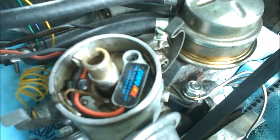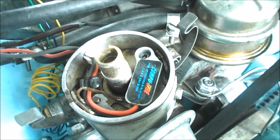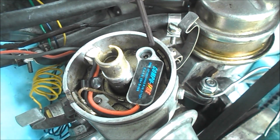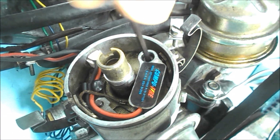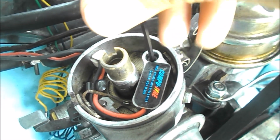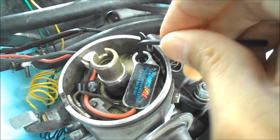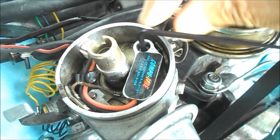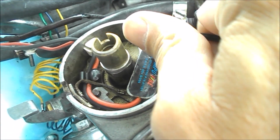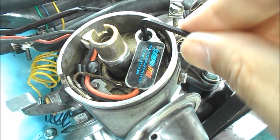Alright, there it is. Is it in focus? Yeah, I think it is. A quick optical inspection indicates to me that it may actually have backed out. I hope this is the right size wrench. It is. And look at that, you can even see it moving around. It had in fact backed out. Holy smokes, people. This was it. A loose ground. Alright, I'm going to torque it down a little bit tighter this time. Maybe I'll go out and get some Loctite at some point. But wow, that's awesome. That means I can make my mileage run. I can take down tall grass. Awesome.